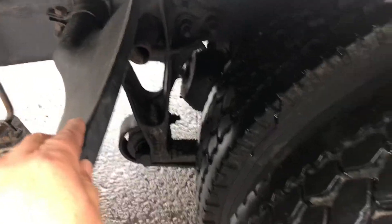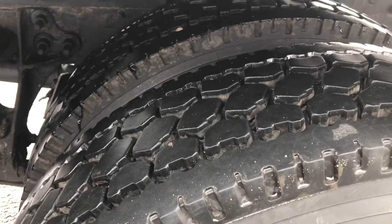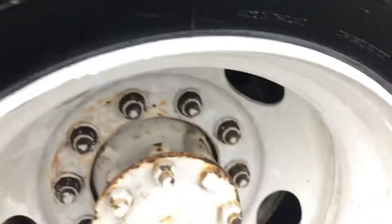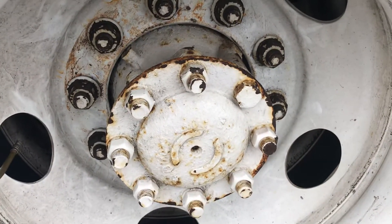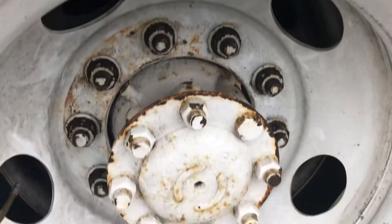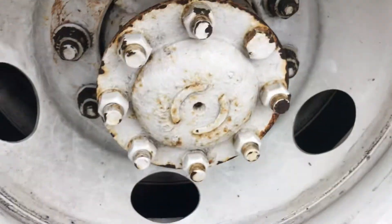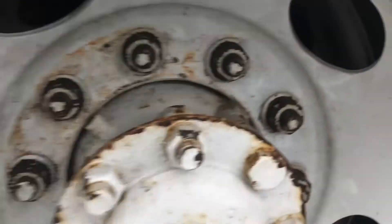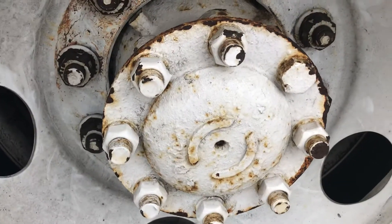My spring hanger is secure — no missing bolts. I kick both my tires for proper inflation. Tread depth should be evenly worn — no less than two thirty-seconds of tread depth, can be a recap. My sidewalls — no cuts, cracks, or abrasions. My rims — no cracks or welds. My lug nuts and axle bolts are all secure — no rust, no shiny threads which indicate looseness. That's where I would check and fill both my valve stems. Metal caps are secure, not leaking, and the axle is not leaking.